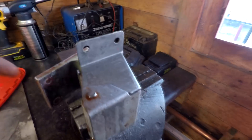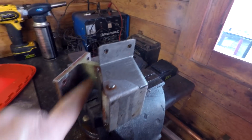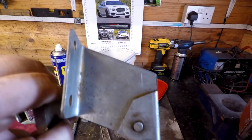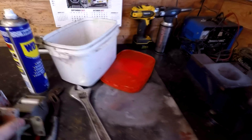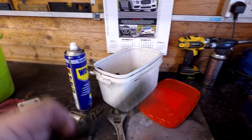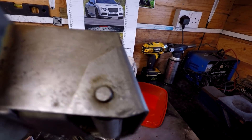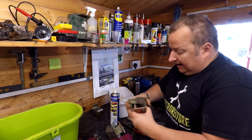That's all I've done, and I'll just persevere with this. As you can see how free that is now — I'll do it with one finger, even my little finger. They're all like that now. Although the paint is still on the main body, I'm not too worried about this. Once you get it to this sort of stage, every other one is cleaned up just as well with just that vinegar solution and agitation with a wire brush. I did do it with a knife as you saw, but the wire brush has worked out even better. In all cases you can see that pin rotate — if I just turn that, the pin rotates. So that's the bits that seize up, not inside here as I thought initially. Basically now I've got them all to this stage and that pin's freed up and is a lot looser now.